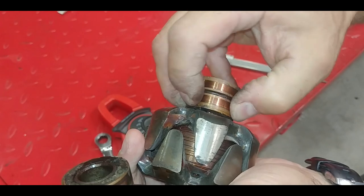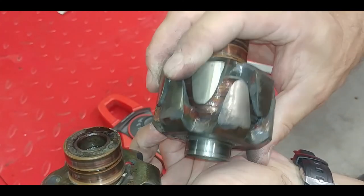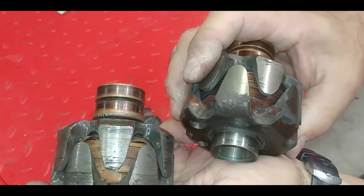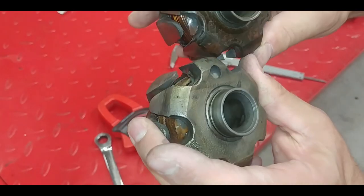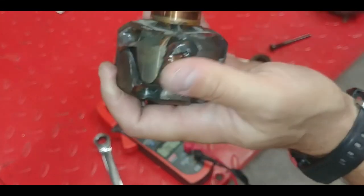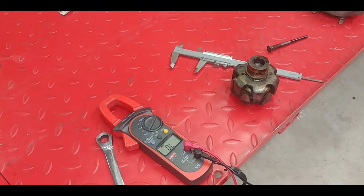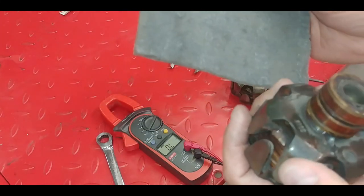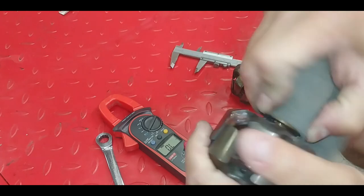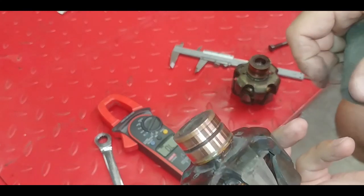We're going to be happy with the one that we have. I'm going to clean the commutator again, just gently with some steel wool maybe. Blow this all off. Don't use any chemicals — the copper windings in there are all just coated with some lacquer to insulate them, so you don't want to get any chemicals on it. This is for sure a Bosch part and this might be something else. This is actually in pretty good shape. The commutator doesn't have any sharp lips here. To clean up a commutator, I just usually use this super fine Scotch-Brite — I think it equals 1,000 grit — and then I just put it on there and give it a couple rubs. That cleans up the copper slip rings.